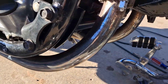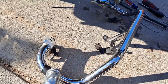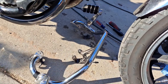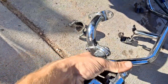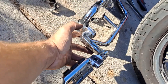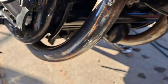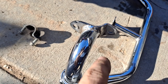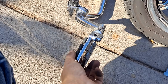If you want to change the starter motor, you do have to remove this. Otherwise, you can put in the exhaust with this in the way, and you can adjust the valves with this in the way. Of course, if the engine ever has to be removed, this must be removed first. You can see someone added highway pegs to these — that's what makes these really nice, actually. It gives you a good place to mount highway pegs, because otherwise it's very tight in there between the frame and the cylinder head. The only pegs you'll actually fit in here are usually only the Honda ones, and even those struggle. So it's usually best just to find the Honda OEM bar and then put whatever pegs you want on there for yourself. You can see these have extenders and everything.